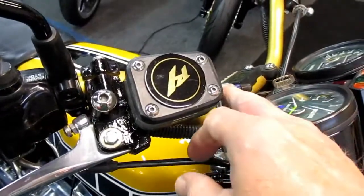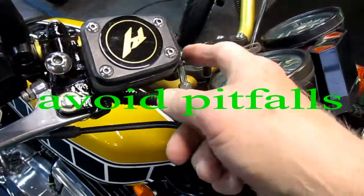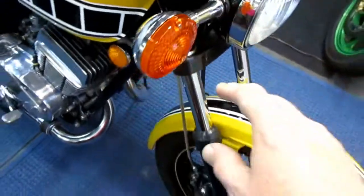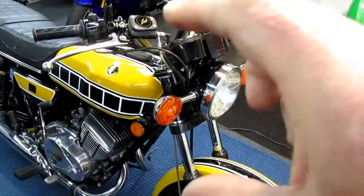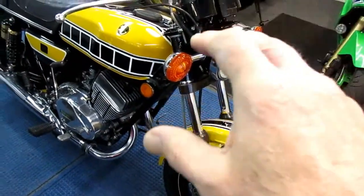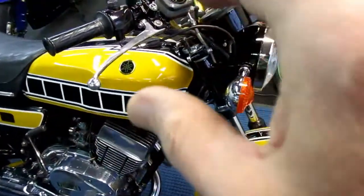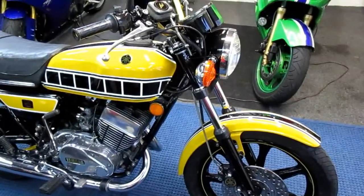There are a few pitfalls to think about when you're going to replace a brake line. The biggest pitfall — the number one thing you can do wrong — is measuring the brake line too short, so there's not enough clearance and it's constantly rubbing on things. I've ordered them off Amazon, they're about $12 a piece. The biggest thing you can do to make a problem is not protect the paint on a bike and drip some brake fluid on it. Think of brake fluid as paint remover and you're not far off.